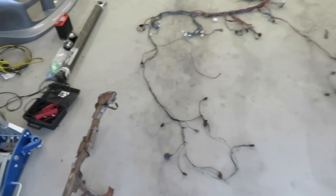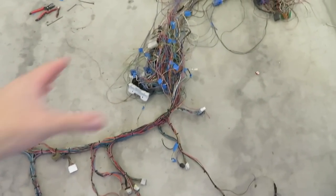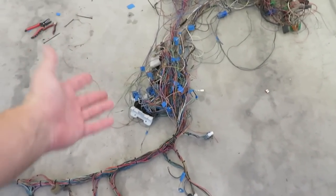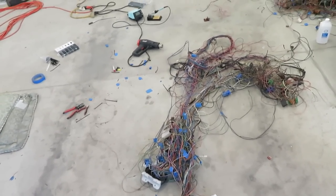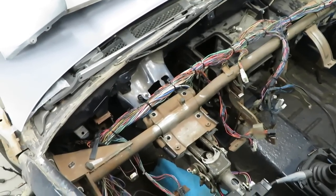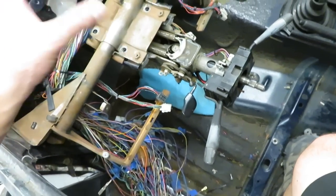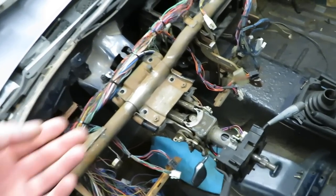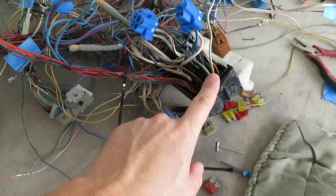Just leaving Walmart — I got some more solder since I ran out, and some water because the water out of the faucet started tasting like salt water. Finally I can say the wiring harness is done up to the fuse box — that's really what all of this bunched-up stuff is. Once I do the fuse box, all this will go away. The back harness was stock and I don't have to modify that at all. Test fit the wiring harness for the dash and everything fits very nice. The wires down here that were too short I extended, and now they have a little slack in them. You don't want stuff too tight. Organized the S13 factory fuse box inside the car.